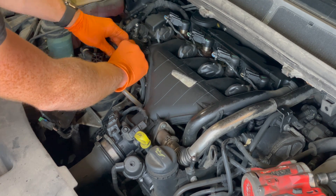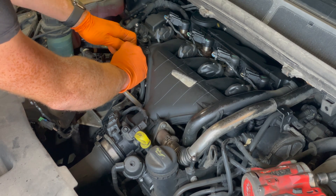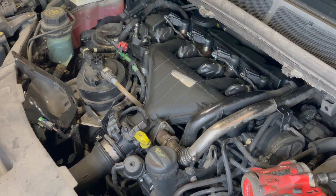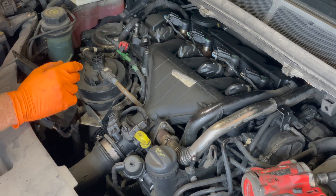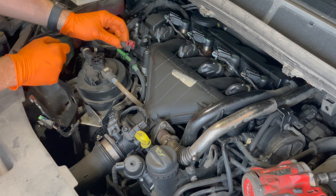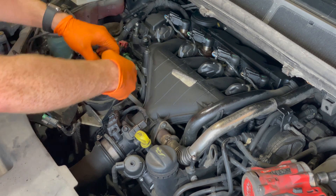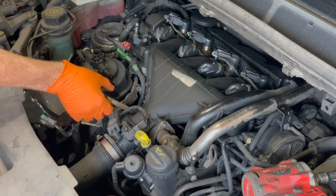Some kits, such as the kit I've got — I've actually gone for a Bosch fuel filter, there's no recommendation here — do come with blanking plugs like this. So you disconnect the fuel on that one: you pull the red tab up, this one you push the white tab in, this one you squeeze like this. They come out pretty easily.